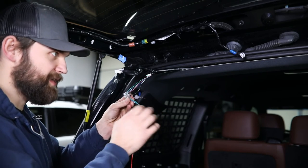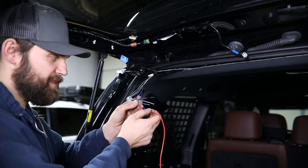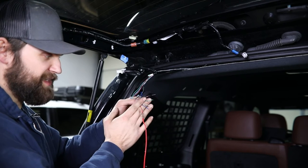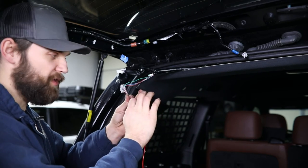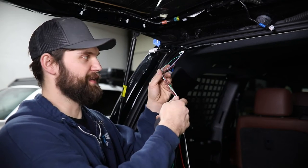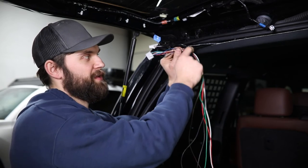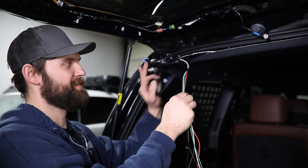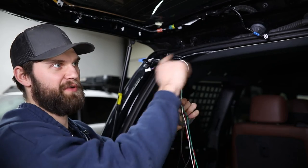Now we're going to do the same thing for the rest of these wires and then begin our wire routing. One more thing you can do while making these connections is stagger these butt connectors — put two out here where you cut them, and then come back just a little ways ahead with the next two wires. That'll keep this more low profile when we put everything back together, tape it up, and begin our routing. Once you've made all these connections, go back and electrical tape all this up and tidy it back up, routing this similar to the way it was before and leaving your new wires to run out this direction. Before reconnecting the harness up at the vehicle, go through about every six inches and put a wrap of tape to hold these wires nice and neat everywhere that they route inside of the vehicle.